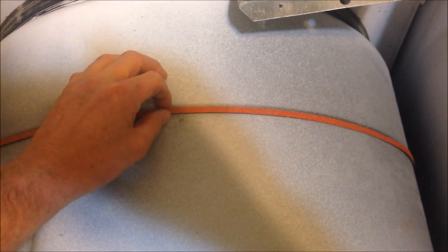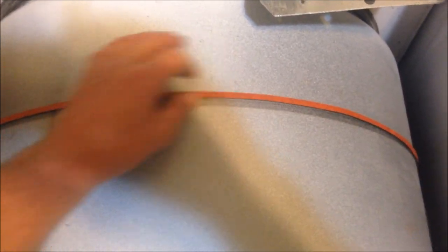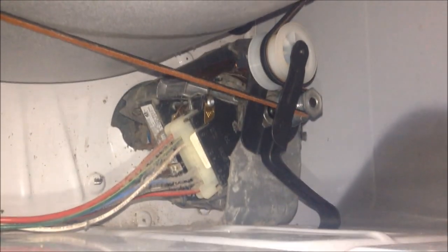All we do with that is just lay the belt back over that drum — you see that line right there where the belt used to be — and then we'll put the idler pulley on the bottom and swing the belt over the motor pulley. I've placed the belt over the drum. You want to make sure that the ridged side of this belt goes towards the drum. Turn it around at least once and make sure everything is straight before you go underneath and put your idler pulley on and install it on the motor pulley. The tab goes down into the slot and those little fingers will go down like that. Then thread your belt under this pulley and the loop that you create goes around the motor pulley.